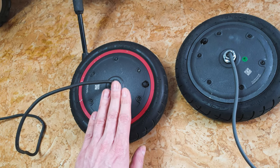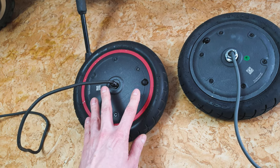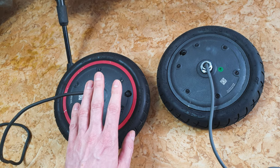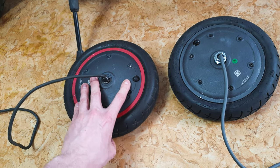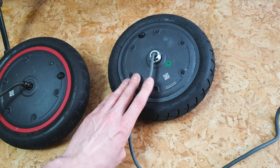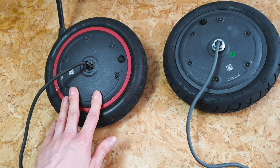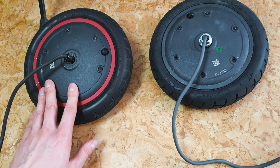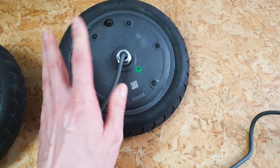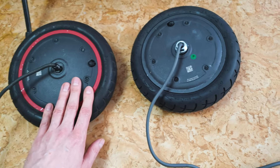That's why I recommend using only Xiaomi Pro motors for this two-wheel drive project, because they can handle much more power without burning. For this project I'll do some testing — on the rear wheel I'll use a Xiaomi Pro motor since the rear wheel handles bigger forces, and on the front I'll use a classic Xiaomi motor. But honestly, I recommend using only Pro motors, since they can handle more power for longer — we'll be pushing up to 1,500 watts per motor, though I'll limit it to around 1,000 watts to avoid burning anything.